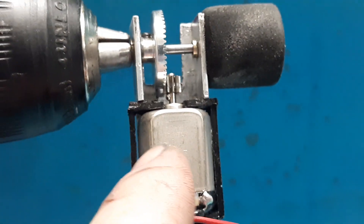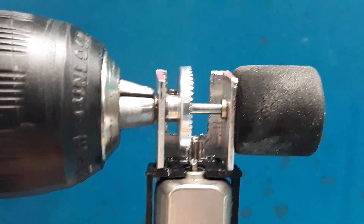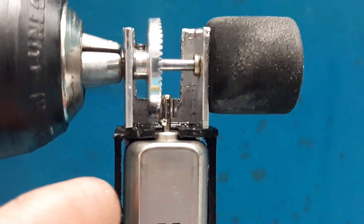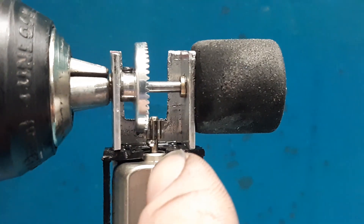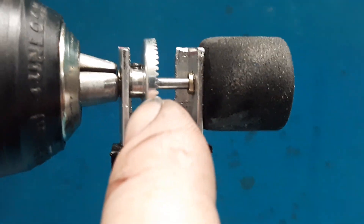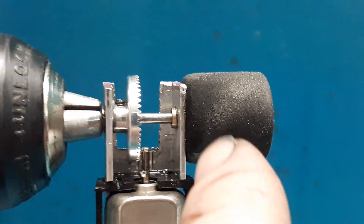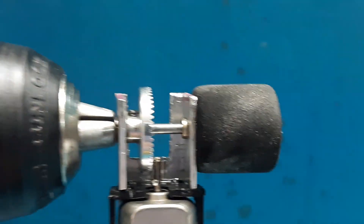One thing to take into consideration is if your motor happens to spin faster in one direction than the other. I've cleared enough of this aluminum, or I can swap this gear around to the other side if I need to rotate it. That's what makes this inline setup so much nicer — if the motor was parallel with the rear axle you'd have to flip the whole axle over, whereas this way you can just flip the crown gear. So if the motor spins really fast to the left and it's going in reverse, flip the crown gear over and it will go forward very fast.